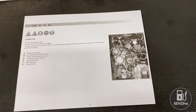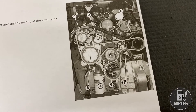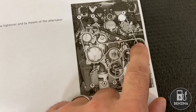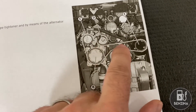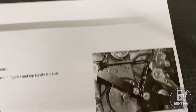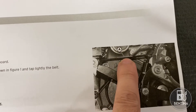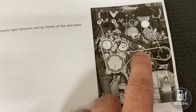If you reference the service manual it will show the path that the serpentine belt takes. The place that we're interested in is right over here between the alternator and this idler pulley, and over here is where you actually take your measurements. There's a close-up of it on the next page again shown with the letter A, and between here and here is where you take the measurement.